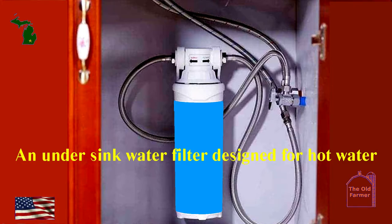Don't go below the 1-micron filter size because you are now fooling around with the atomic structure of water. You can strip an ion or two out of the water, which will make it up from any place it can, such as the metal or plastic pieces in your dishwasher. The filter shouldn't need to be any larger than that of a typical school lunch vacuum bottle. You may need to pick up some adapters to make everything go together.